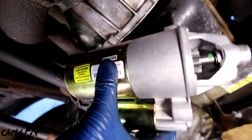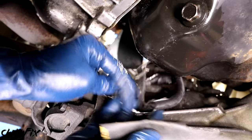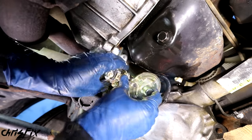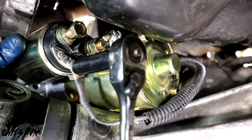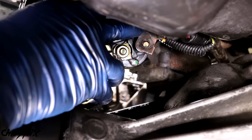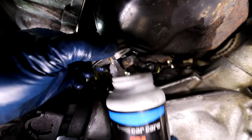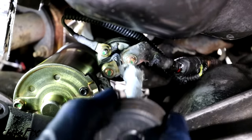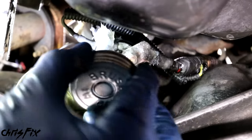Now back under the truck we can install our new starter. Before we put it back in, we want to clean the wires that are going to attach to this so we have a good electrical connection. Use some sandpaper and just sand away any of the corrosion. Now with both wires prepped, let's squeeze our starter back into place. Connect the two wires - the other wire is shorter, so we have to move the starter to get the wire over the post, then tighten it down. Next is an awesome trick that prevents corrosion and keeps the starter running great - using silicone paste on the wires we just tightened down. Silicone is an electrical insulator and it's hydrophobic, so it prevents water from contacting the posts and wires on the starter. Give the exposed metal wires a light coat of silicone.